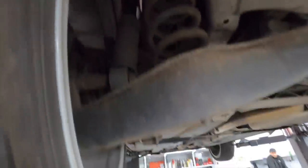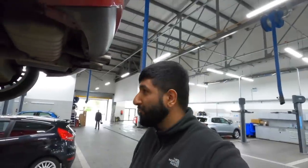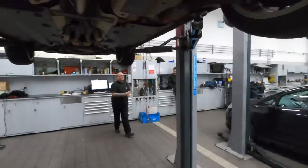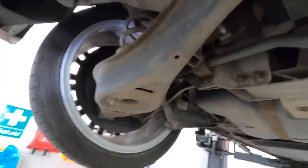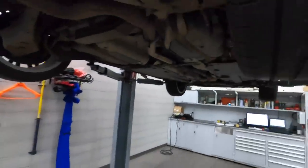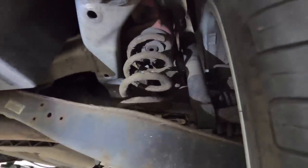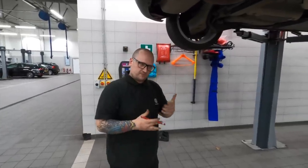The shocks look pretty fresh. Little things like the bump stops have fallen down on this one — minor, just a dust cover. The rear springs are corroded but for the age of the vehicle that's completely normal on these Mark 5s. If you're going to throw coilovers at it, you don't even need to worry about it. Most people buy a car to build upon anyway — there's no point chasing perfection, particularly on a car this old. The gearbox rebuild, the diff rebuild, the chain — somebody spent some money on this.